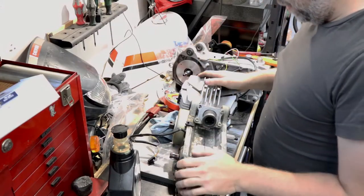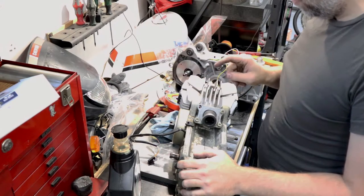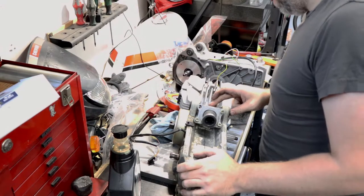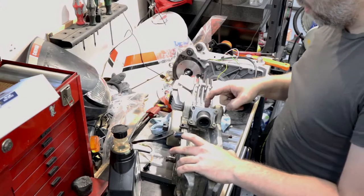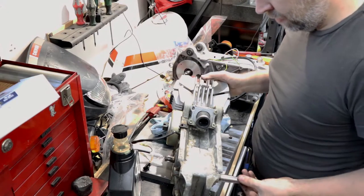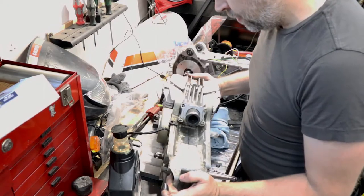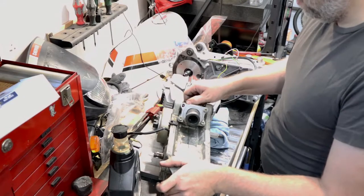Okay, so that's out on the bench. You can see I got a BRK 70 kit on here, and I can't remember the kit, it's an Italkit, intake, and Malossi reed block. Other than that, it was stock. You can see the damage there coming to the end of the shaft. So, let's pull this off. Those are the only two things I really need off of this.